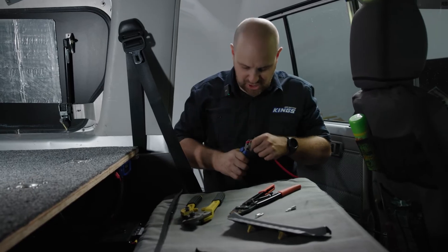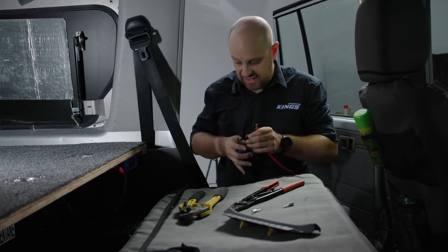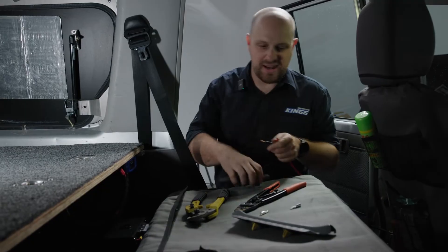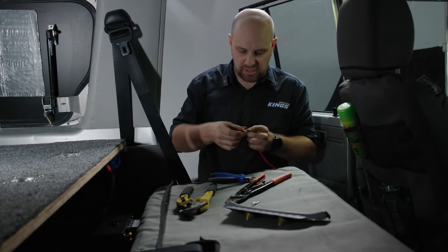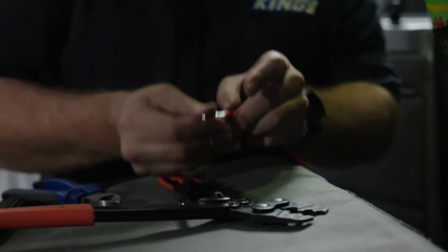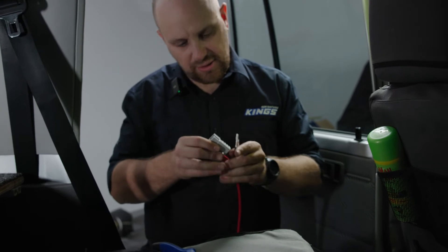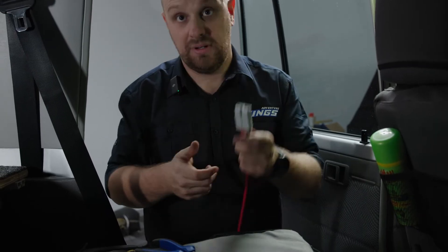It is the home stretch, but I can't stress this enough — still take your time here. These last couple of connections are as important as anything we've done so far, and probably a little bit more important, because if you don't properly crimp these connections down, you're going to add unnecessary resistance to your cabling, which increases voltage drop, increases amp draw, and means your second battery is not going to charge properly. Always give it a little tug just to make sure it's on there nice and firm. Put the quick connector housing on — it always seats with a nice satisfying little click, and that's how you know it's in place.